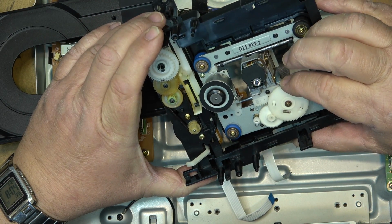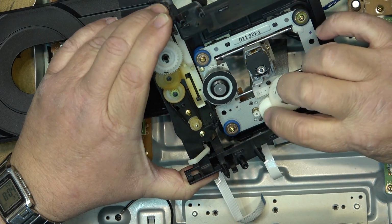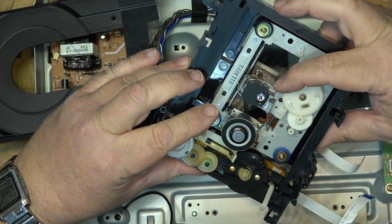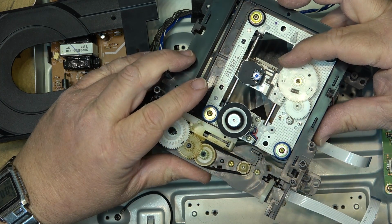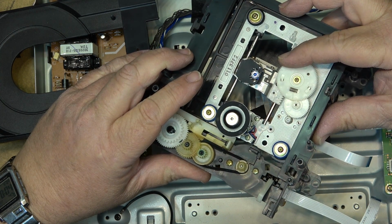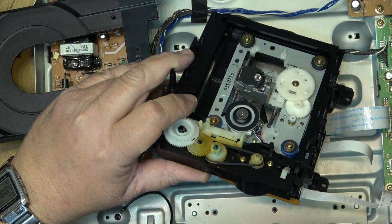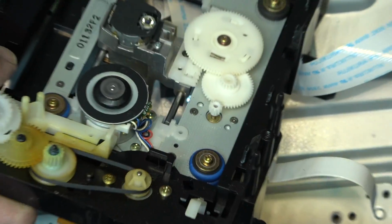Oh yes, there's definitely a crack, probably in this little gear here. Let's get a close up. I can feel it as I turn it. I can feel it like a tick, tick, tick, either a crack or a grain of sand, but there's something that's sticking. Oh, it's a crack. It's a crack in the gear. See this? Right down here, there's a crack in this gear.